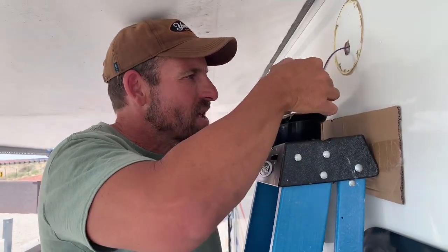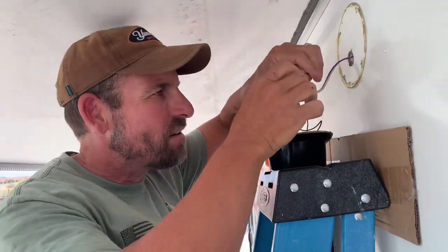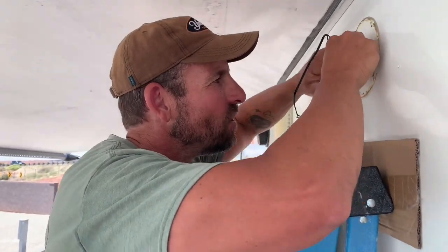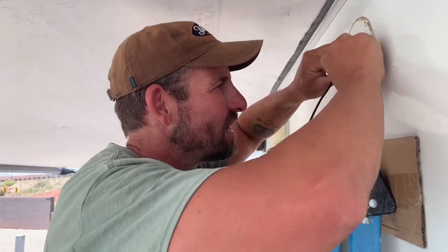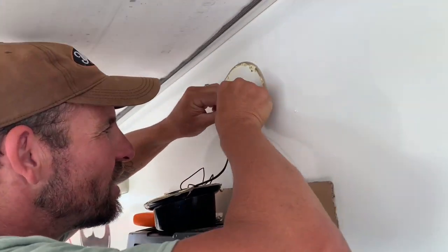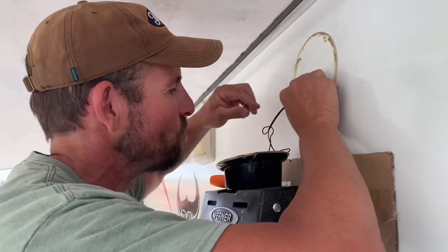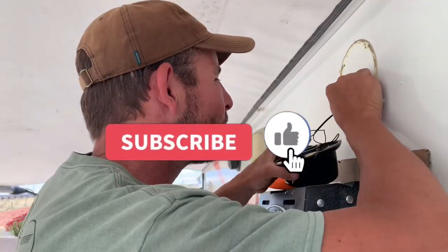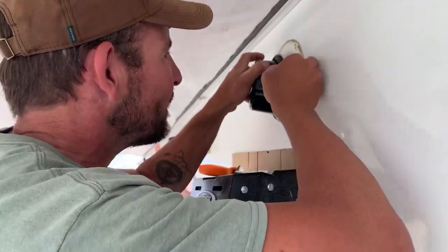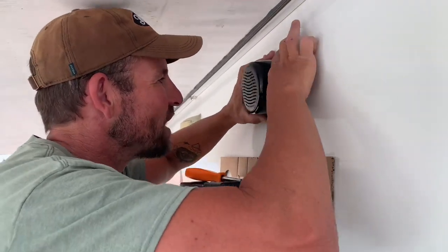The RV wire is a little thicker, so get some electrical tape and make sure you tape it up real good, nice and tight, and just shove it back in the hole. Be careful not to pinch the wires or have them touch each other so they short out — make sure they're taped up pretty good. You can tuck that around the side there; that goes to the bottom.